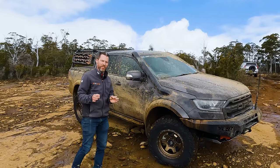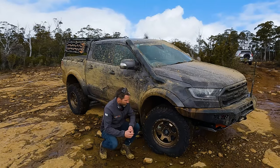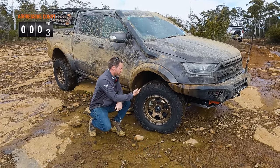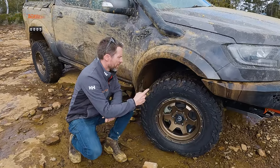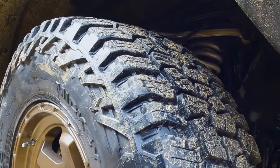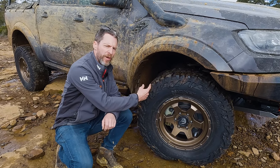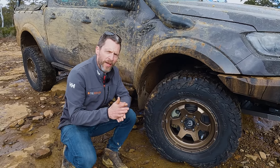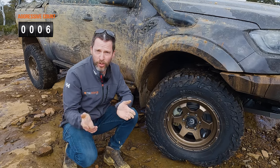I just thought I'd take a minute to go over the basics of the tyre again. These are the Mickey Thompson Baja Boss, currently at about 19 psi because we're off-road. It's an aggressive all-terrain tyre. I can fit my finger into most of the gaps on the shoulder lugs, but the central lugs are actually more densely packed. That means it gets the best of the all-terrain world through the centre lugs, and some influence from the mud-terrain world through the shoulder lugs. The hope is that they're good, quiet, and relatively tame on the road, but still aggressive enough to handle pretty much most of what you can throw at them.